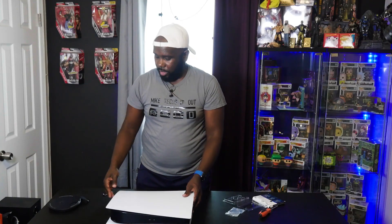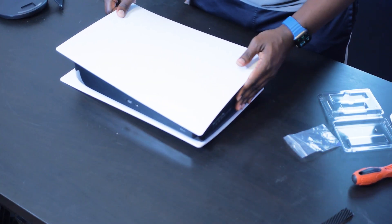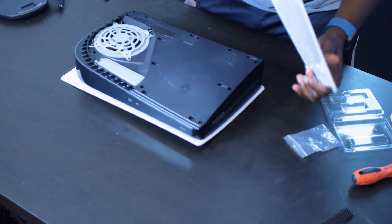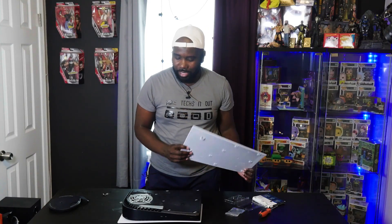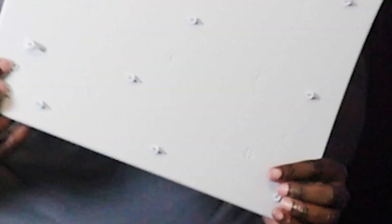To remove the stand, you want to lift this corner — it's adjacent to the corner that has the PlayStation logo. You lift it up about a half an inch and then push. I just threw this halfway across the room because I put too much force on it, so it's important not to use too much force. There are two holes that match up with the screw holes, so you're going to have to lift them out in order to push out the side plate. Just a heads up — I scratched my side plate, so be careful with that.